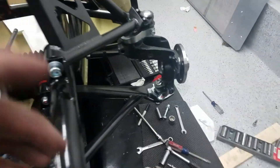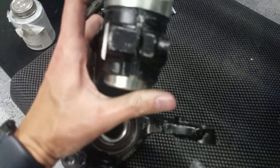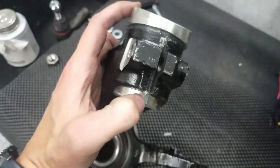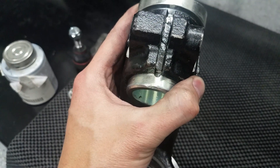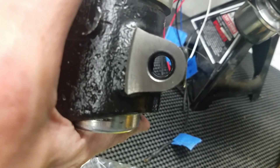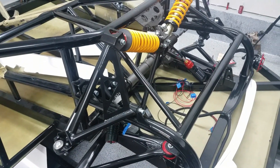There's one more that we need to do right here, and I'll show you on this other side what's going on. For this piece, it's got a keyway to keep things from rotating, which is great. But when you go to put the screw in, you can see it's just occluding that one side so the screw doesn't want to go in. I'll need to get a drill bit or something to clean that out. That's the last thing I need to do on the other side, and then I'll redo all of it on this side.